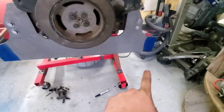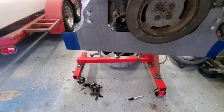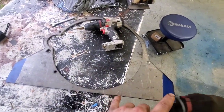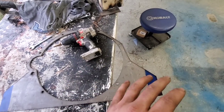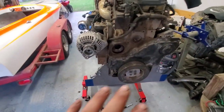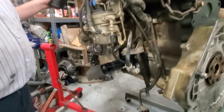We have layout fluid on the front plate, and when we did the math, we need to take off — on this front motor plate — 9/16ths off both sides. On the rear motor plate, we need to take off 15/16ths on both sides. That'll get it down to the 24 and 7/8 with both sides still being even and the crank centered. We'll use the precision scribe or calipers, get it marked up, get them cut off, and we'll be one step closer to having it in the boat.